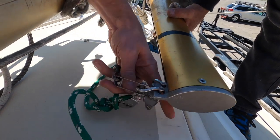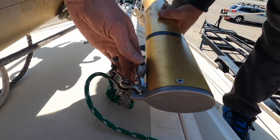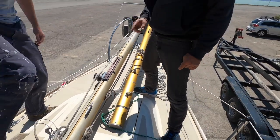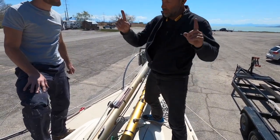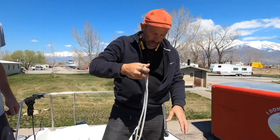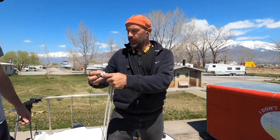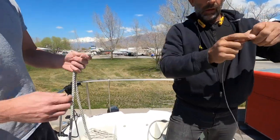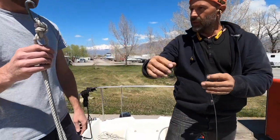And then this other pulley is the one for the main sheet outhaul, or the mainsail outhaul. Next thing we need is a line that is fairly long. We're going to hook it here and have it go down to those points to create these things. It can just be done with a rope. This is adjustable, so I've got a way to adjust this length on here. This is going to connect onto the boom, and then we have adjustment here that we can make.